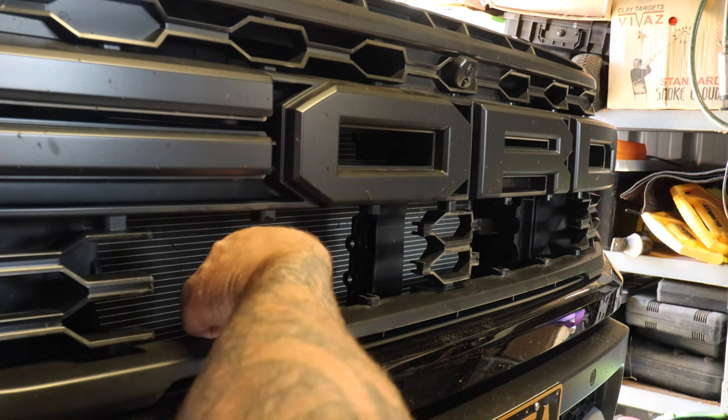And if you get into the system on your front screen, you can actually go through and find out where all those switches are located, where all the wires actually come out. There's different sections around the vehicle where they come out to, and there'll be positive and negative wires there for you for those switches to run whatever you want. And it'll also give you the amperage of what the circuits are.